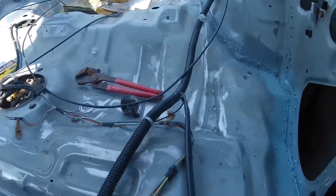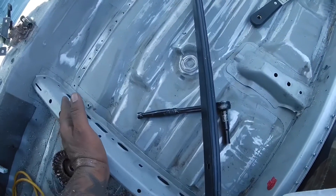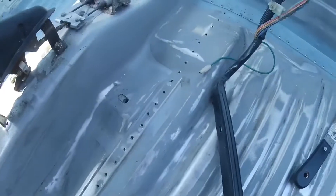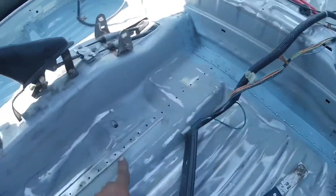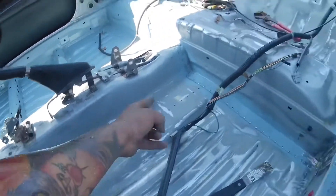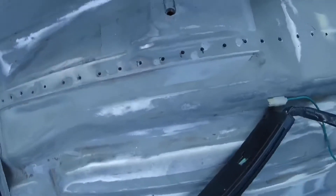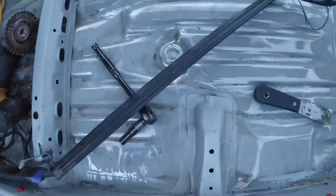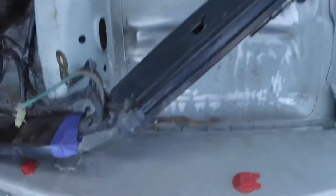In the last clip I cleaned up all the adhesive and sealer over here and on this section up into where the front seat mounts. I got half the row drilled. I changed it up a bit — I did go underneath and drill the first hole, one in the middle, and one up front, spaced out with the sockets. Then I cut the bit down real small and just went through the top so none of the lines got hit. That worked out pretty well.